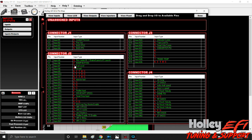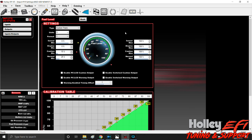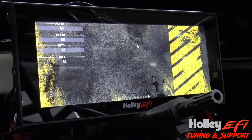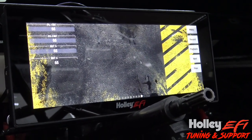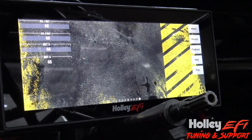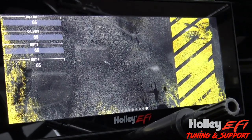Then come over to the pin map, find the input — there it is, Fuel Level — and drop it over to a T-type input. Once that's done, send it to the ECU. Then we can add it to the dash, which I'll show you now. Let me get my girlfriend to hold the camera, I'll get in the car and show you on the dash. We've got our input set in the ECU — here we are at the dash and we are going to create a custom gauge.